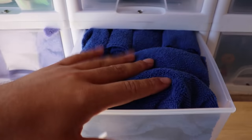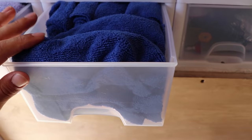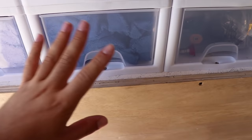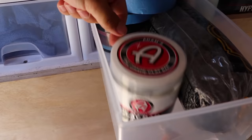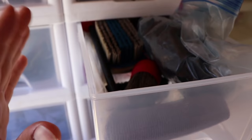In these bins I store towels — these super soft ones are for paint. To the right we've got more towels: Terry towels rather than ultra plush. The Terry towels are great for removing waxes while the ultra plush ones are good for final buffing. When you're using any microfiber towel, always use a detail spray or spray wax — never use it dry. To the right of the towels we've got exterior products — clay bars, masking tape, and wax. Steel wool is good for aluminum or chrome finishes; this is four-zero steel wool.